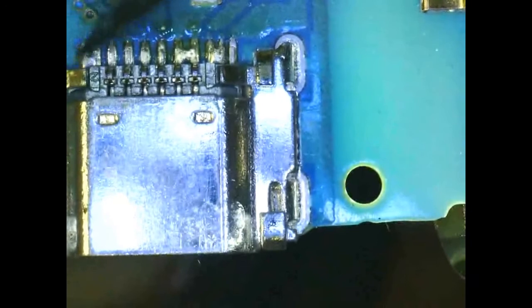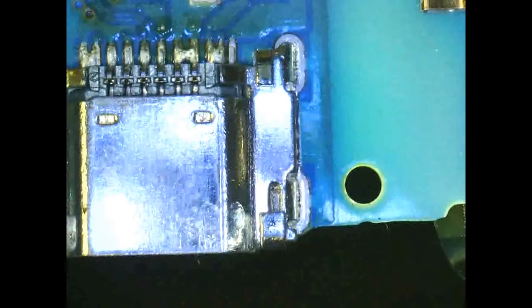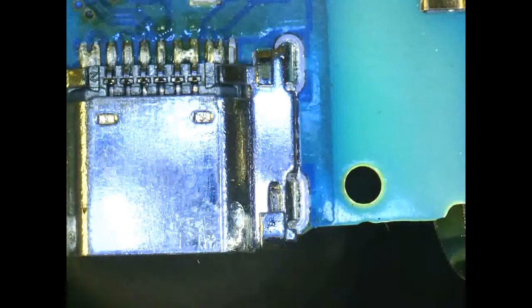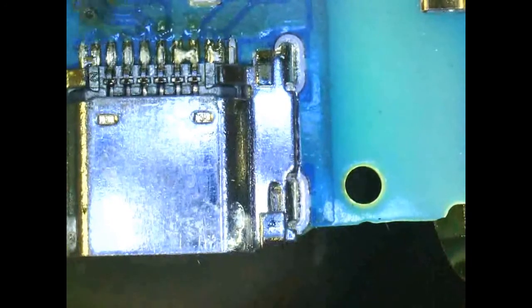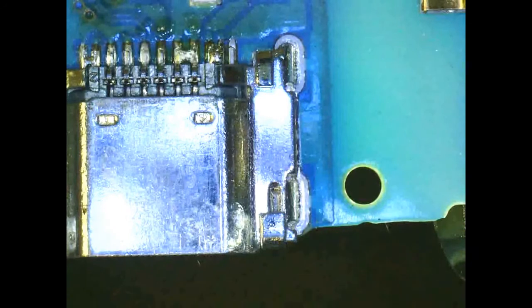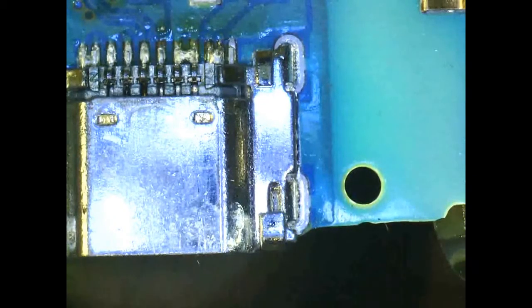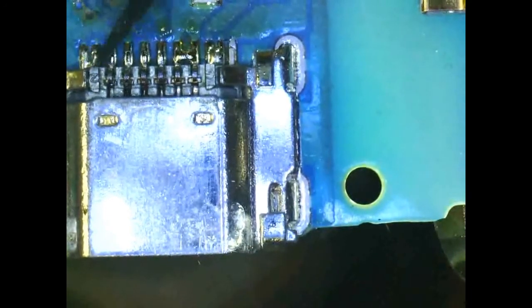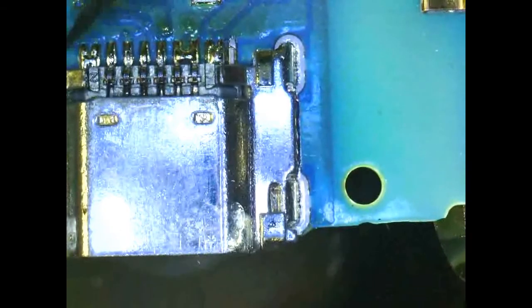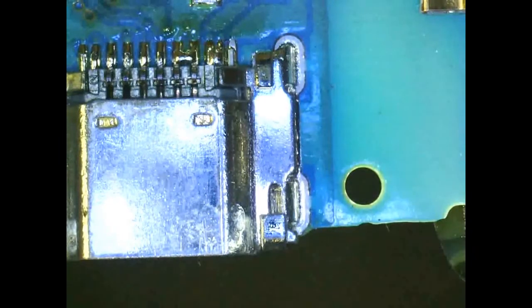Reheating the board repeatedly will cause the metal to become oxidized, and it has to be heated to a higher temperature in order to melt. So sometimes you may need to adjust the temperature a little bit throughout this repair, but you should never have to go hotter than 380 to 385 degrees Celsius, because at that point you risk burning the board, damaging components, or even damaging the charging port itself, since there is plastic in it. Make sure any exposed plastic is covered up, because the inside of the charging port is made of plastic where the pins sit, and there are two holes in the bottom that will allow plastic to melt if not covered.